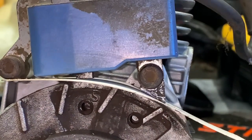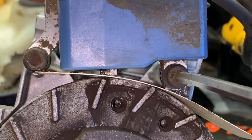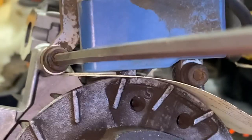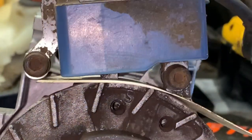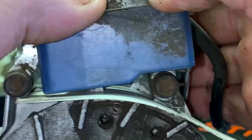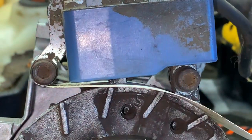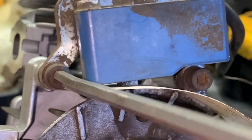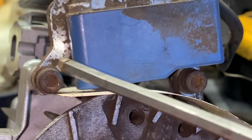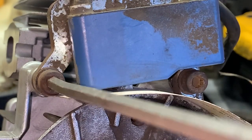Now what we're going to do is loosen up the ignition coil — both legs — and then let the coil drop onto the flywheel, like this. We can even push it down a little bit. The business card thickness, when we remove the business card, is going to leave the gap that we need. Go ahead and tighten down your coil. A little trick here: if you tighten the right one first it tends to kick up the trailing edge of the coil, so always tighten down your left mounting nut or bolt first.